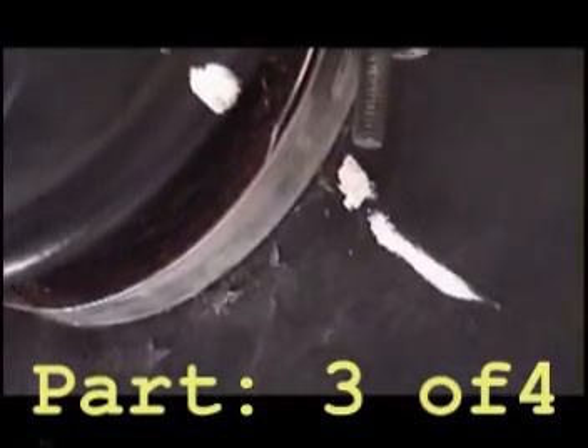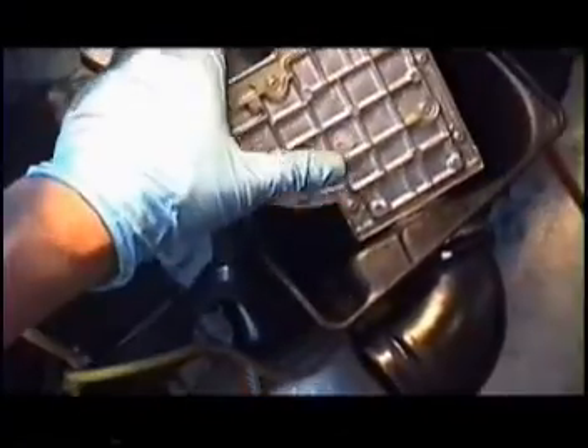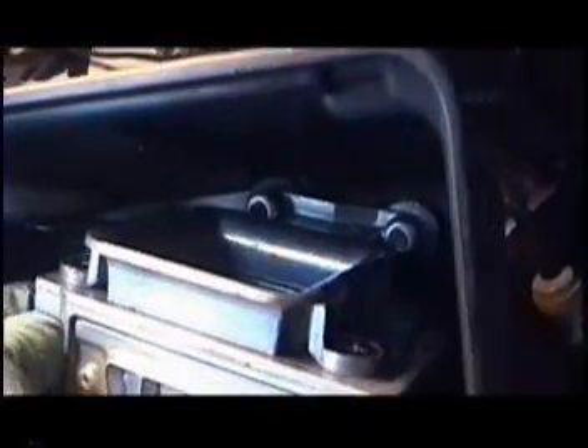There's a tiny plastic mark on the hard plastic and an arrow on the boot, and that will give you the correct alignment. There's a tab on the inside which is going to go in the middle. The best way to deal with this is to get the MAP sensor out altogether. You do that by unplugging the computer or the main fuel injection control unit. Put grease or silicone on the metal MAP sensor in order to get it to slide into the boot. Don't guess where the boot goes — use the alignment marks.